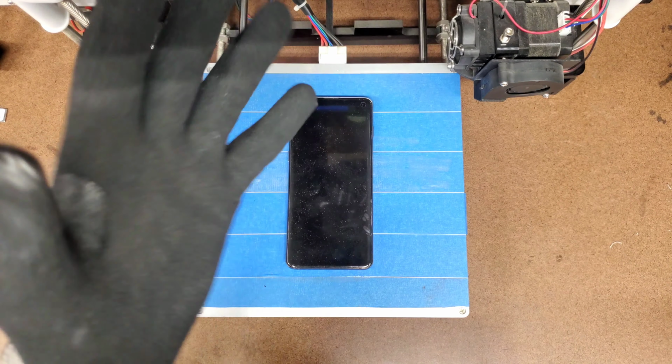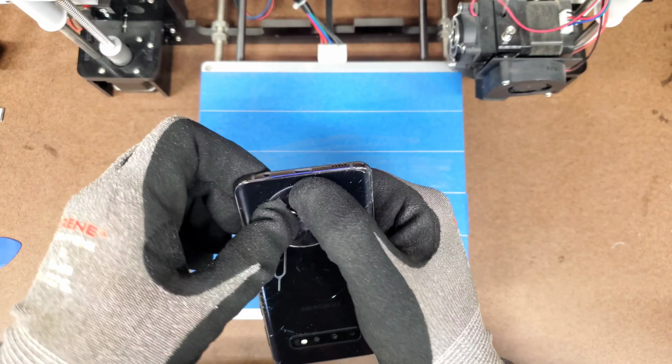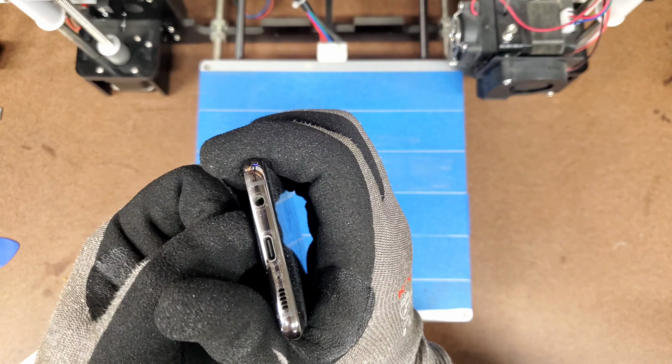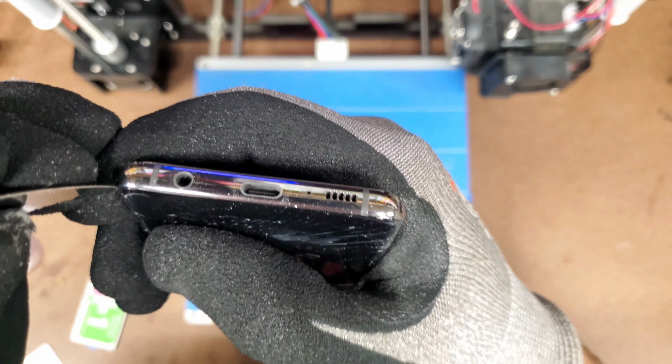It was boring. I tried to use the suction cup at various points throughout that time, but I was unable to accomplish anything. This might be because the cracks were allowing some air into the suction area, I'm not sure, but either way, it didn't work. So I switched over to the spatula knife thingy and pushed it into the one corner of the back panel to start prying it away.